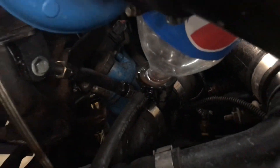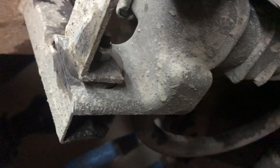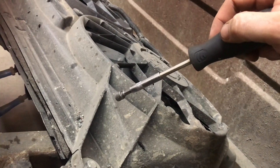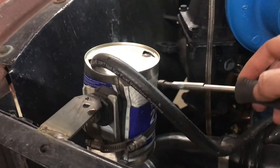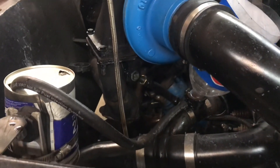We've got to fill up to where it's overflowing so we know where the air is. What I've got to do is let this little transfer hose go — that was for the expansion tank. I'm going to let this hose go and it's going to piece out a bunch of air, then the coolant level up front will go down, and I'll keep going back and forth doing that until fluid comes out. That way I know the very top of the radiator is full. Any remaining air bubbles while driving — going up and down hills, hitting holes — will come up to the radiator cap and out this hose into the overflow tank. After so long, that'll eliminate any air in there whatsoever.